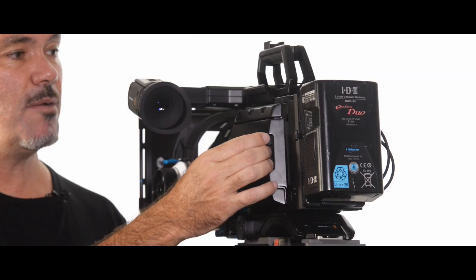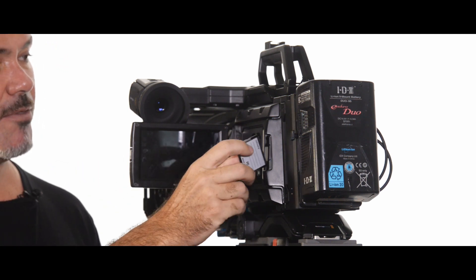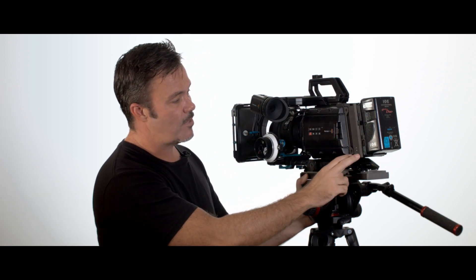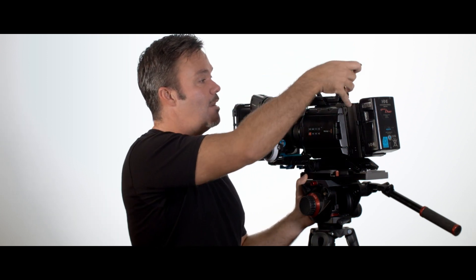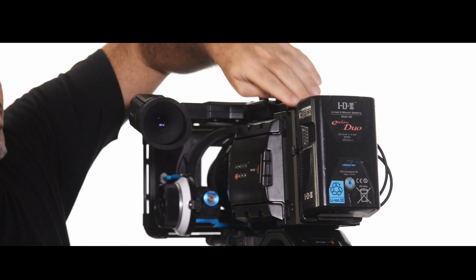What it does do is add an incredible amount of recording time compared to the cost per gigabyte of the CFast cards. For example, I have a 128 gigabyte CFast card in here that was costing me about $300 to $350 US when I bought it. The SSD recorder unit was $395 US, with a one terabyte solid state drive which I added for about another $150. That puts me at one terabyte, as opposed to a maximum of about 250 gigabytes with the CFast cards.